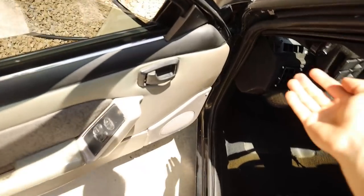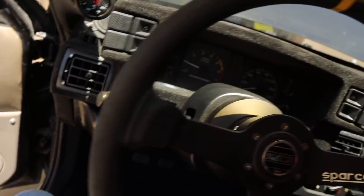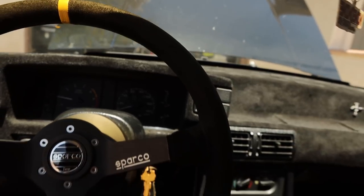It really just wasn't enough pressure. Coming inside the car — it's cold now! It's stuck on defrost and I don't have the right vacuum lines up top, but I'm going to go drive around the block with the windows up and it's hot out. I used all of that 12-ounce can — the system was empty so I had just a little bit in it from previous tries. I'll need to go get one more of those. Still like 30 bucks total, cheaper than buying the large one. It is charged, but I want to go drive it to put a load on the system and let it equalize.